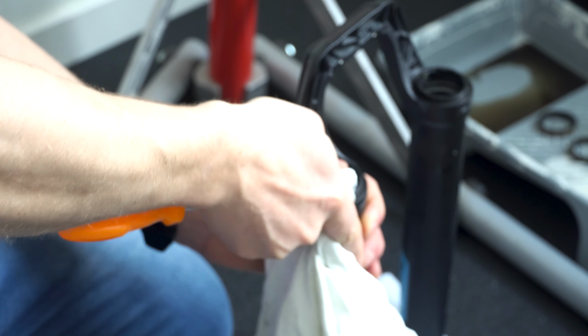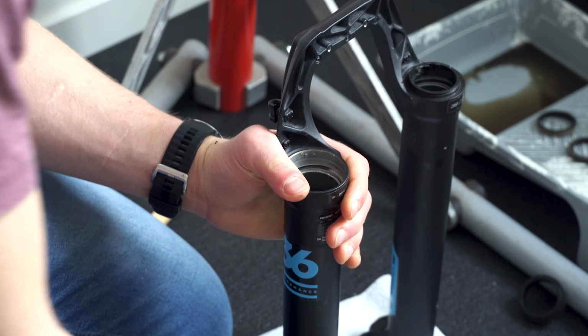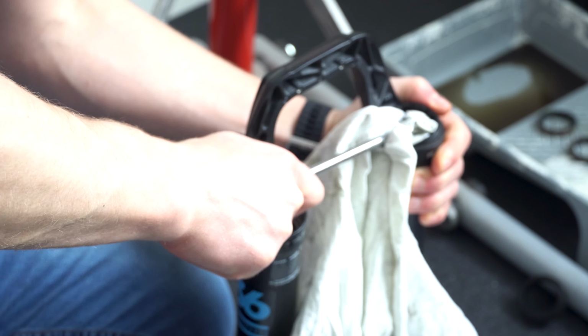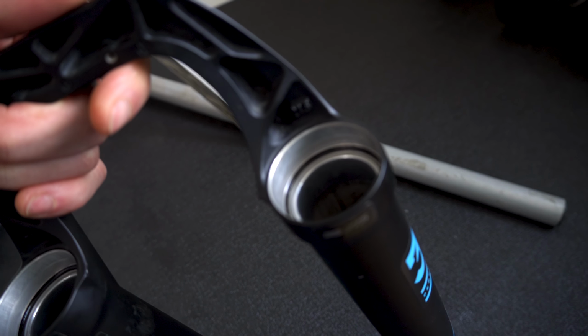See, here's where things can go drastically wrong. The dust seals are jammed in there pretty tight, so they need to be pried out with something strong, like a flathead screwdriver. A decent amount of force is needed to pry these suckers out, so I wrapped the screwdriver in a rag and carefully jammed it under the seal just above the top bushing and pushed down on it. And presto, the old seals popped out.